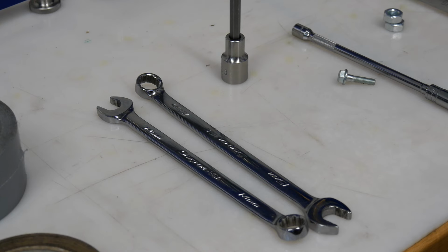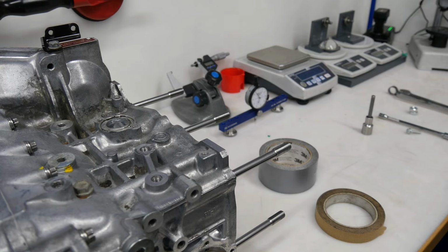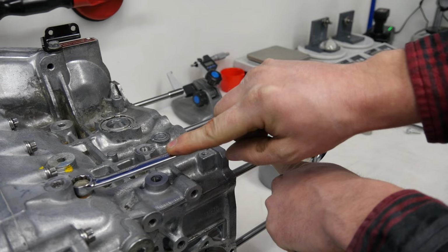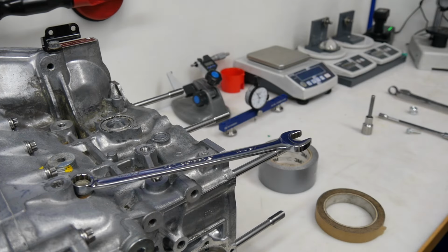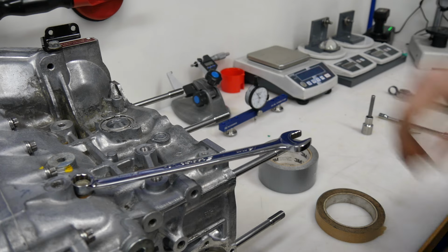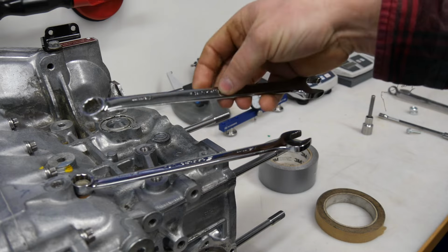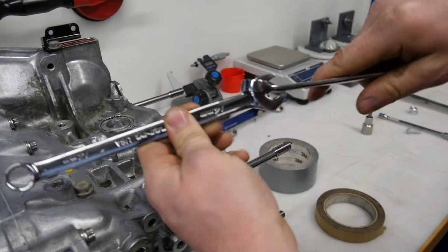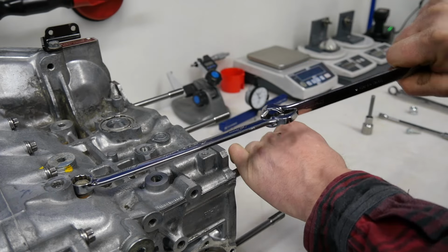The super mechanic hack number 1 is the wrench trick. We all know that problem when we have a hard tightened screw and we can't open it with a short wrench like this here. But you currently have no special tool, and you can't work with a ratchet or something like this. You only need one bigger wrench. Do it like this here. So you have a much longer arm and you can open it easily.